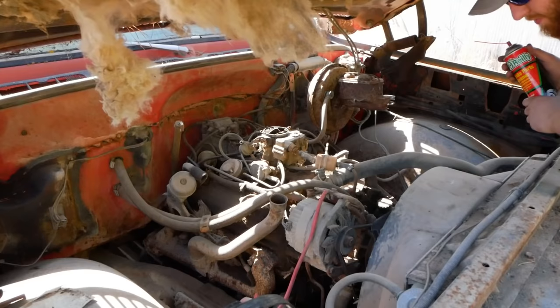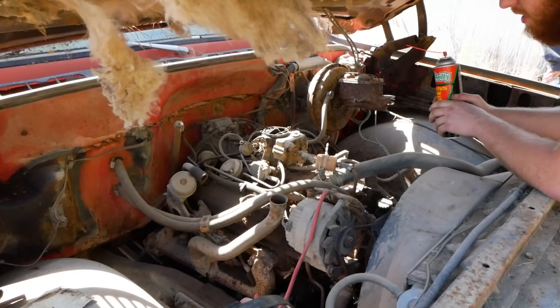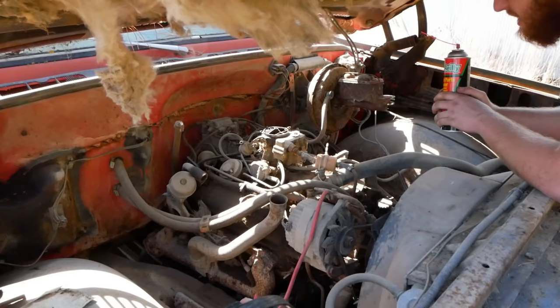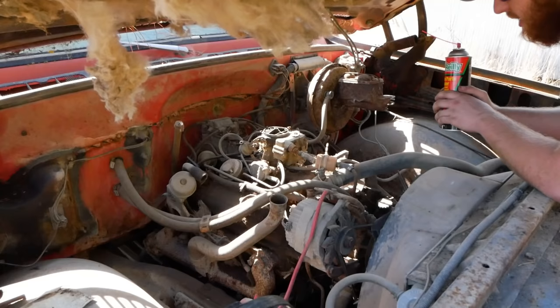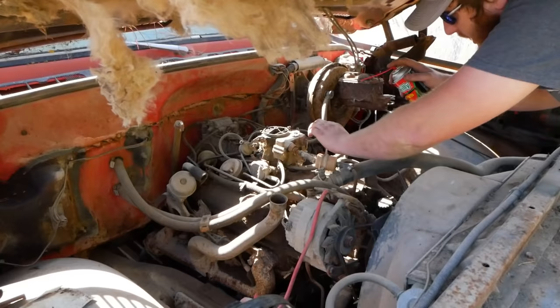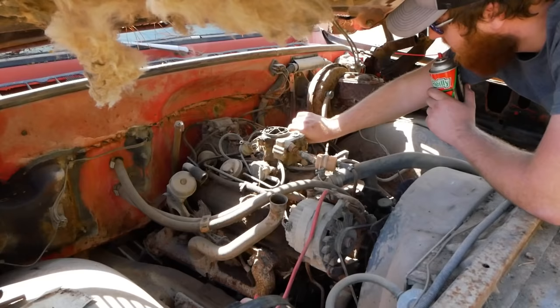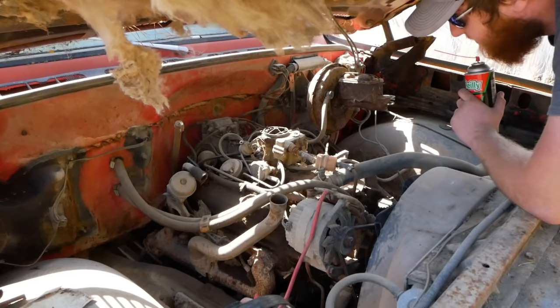Something seems to be ungood. It's like it's stinky. We've got some fun things going on with the choke there, which means the valve train might not be happy. It's making a bunch of goofy noises, and it's only trying to fire on like one cylinder once in a while. So maybe we should back up and reassess and start from further back. Or we hit it again and see what happens. Yeah, that one! Ow. It does not seem pleased with wanting to be alive.